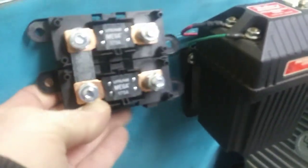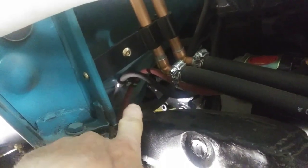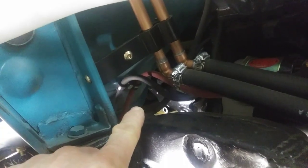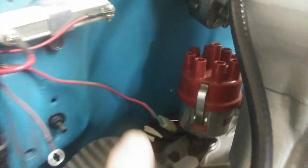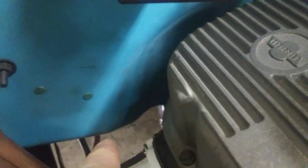I was going to put it up here but then that big fat power wire would come hanging down along with the other wires. Trying to hide all these wires, so I'm going to put it right down there next to that red cable — bolt it right to the firewall. I'll probably drill the back of the tunnel, put a grommet, and that main feed wire will come in from there and go to the mega fuse down below — pretty much hidden away. Then I'll have one coming up across the manifold to the back of the alternator.